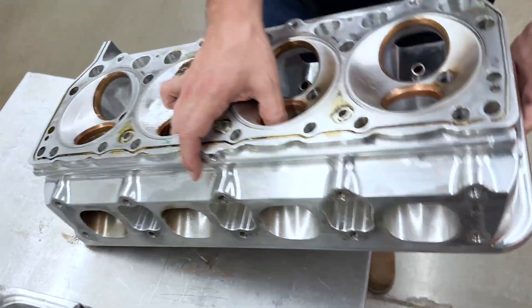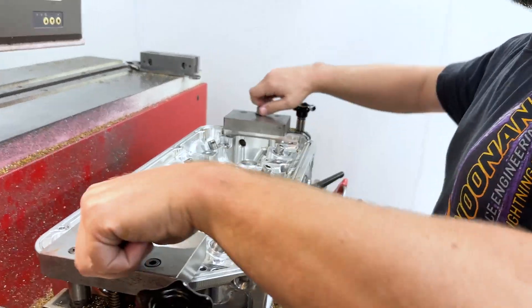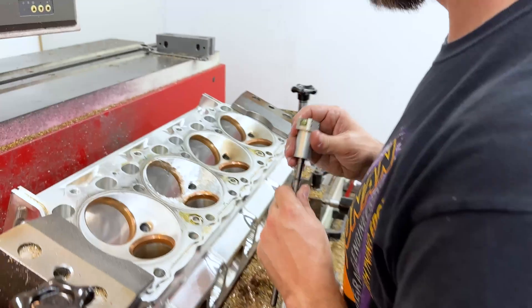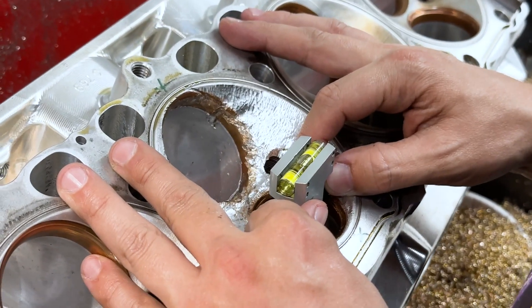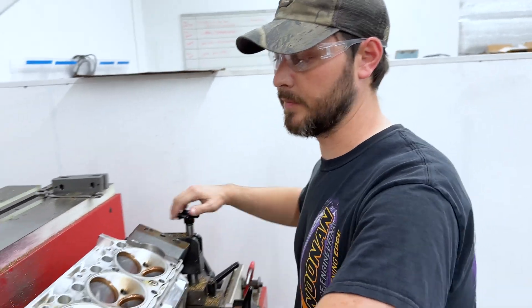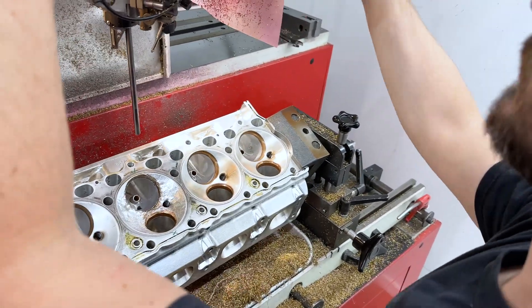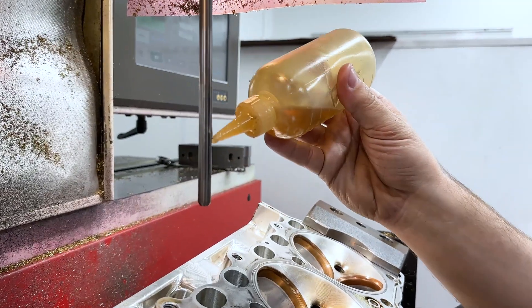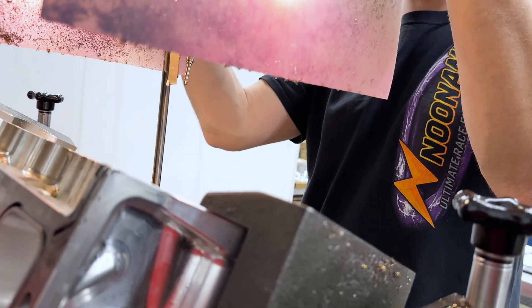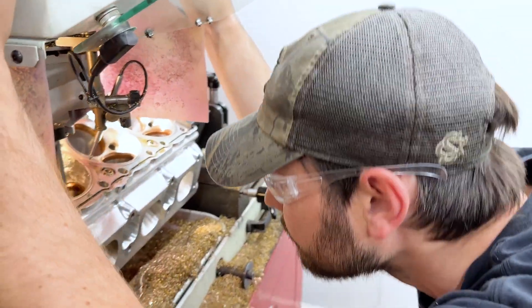Now we've got the new guides in, ready to go. I'm loading it into the Eppic and we're going to cut these old seats out so the welder can do his thing without them getting in the way. I dropped this little T-level in there just to get the head leveled in two different directions, because the pilot's only capable of so much range. I line the pilot up, auto-center it, put a little oil in it so it doesn't stick in the guide, and bring it down into the guide about a half inch from the seat surface.